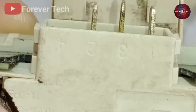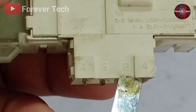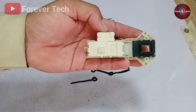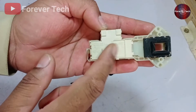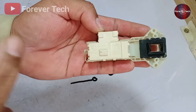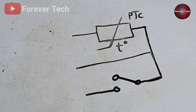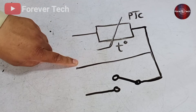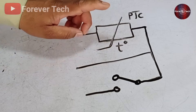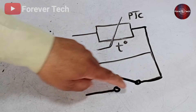Remember the difference: one door lock reads terminals 1, 3, 2 from right to left, and the second reads 1, 2, 3 from left to right. This door lock works like a switch — electrically, without using any coils — made by the best mechanical method. The door lock has a PTC sensor installed in it. One electric point is the first terminal, the second electric point is the next — these are the line and neutral. The third electric point has a switch installed mechanically in the door lock; when this switch joins, this point is attached in series.